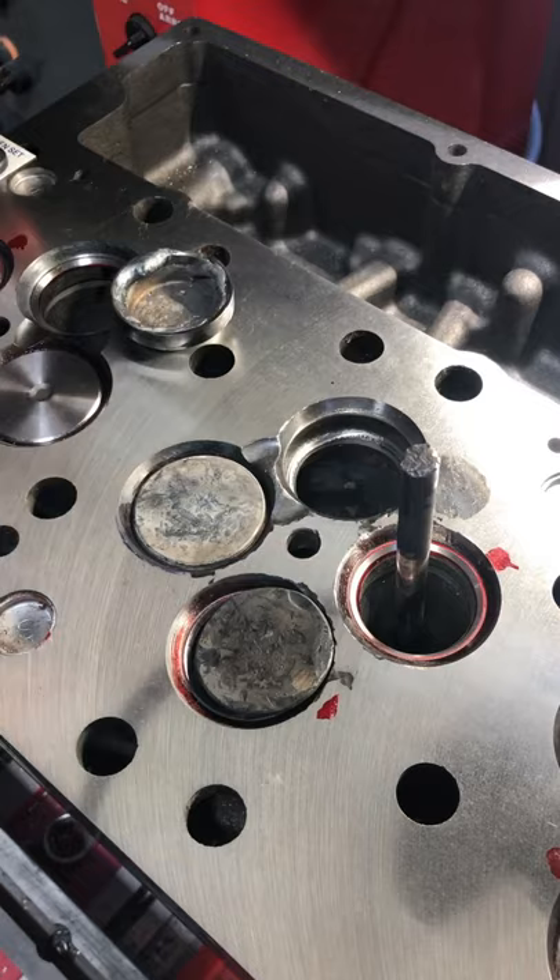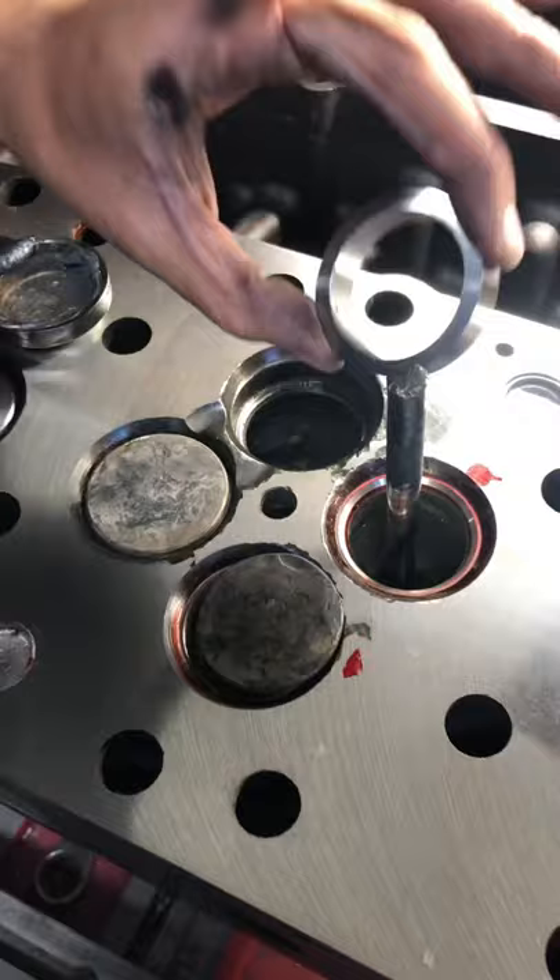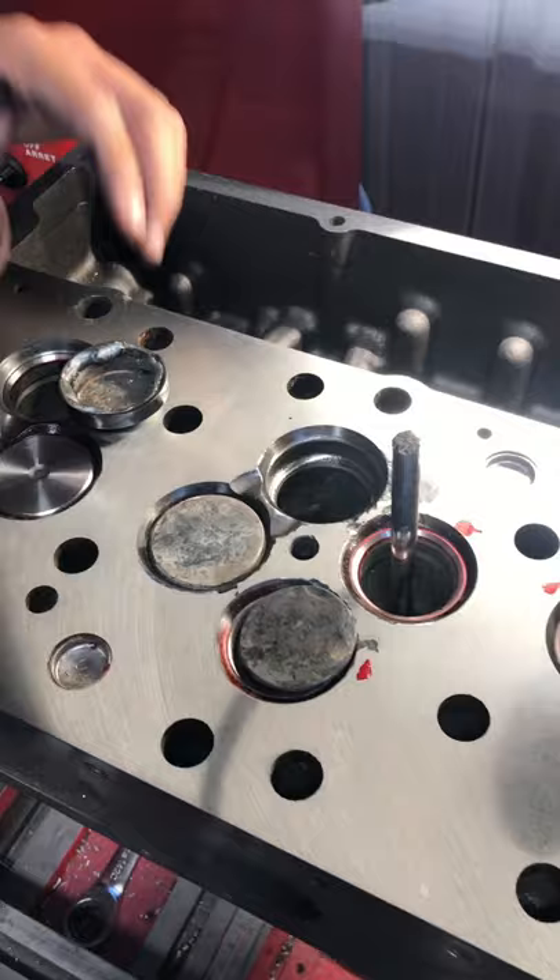But what that doesn't explain is when we took this intake valve out, the seat counterbore below the seat is all screwed up — the bottom of it is screwed up and it's a little bit too big. So we ended up ordering an oversized valve seat, but it looks like that seat was bouncing around loose in there and ran that way for quite a while, despite the fact that the seat was still tight in the counterbore when we took it out. So we want to get your opinion — what do you think happened to this cylinder head?